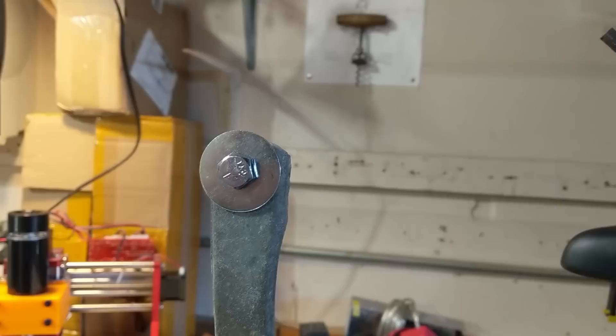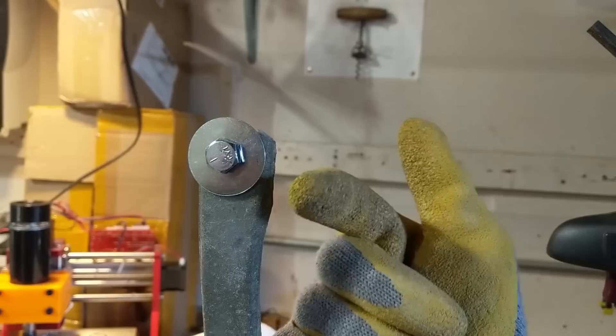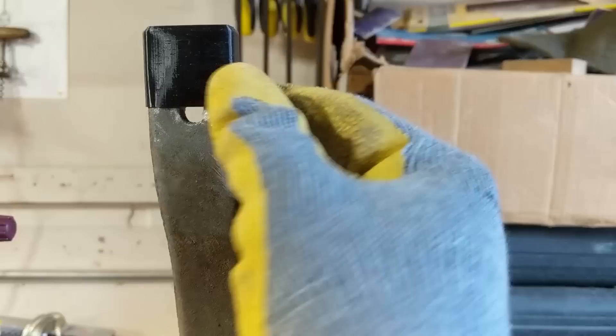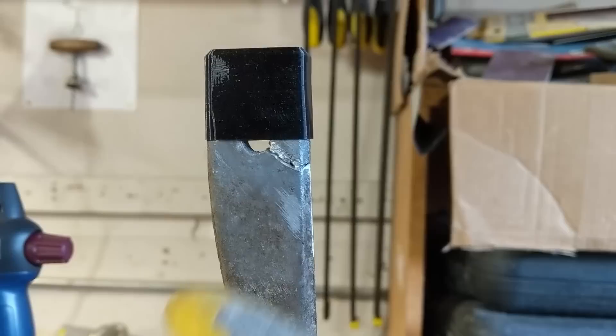The way this is going to work, I'm going to use one of these big fender washers to hold it in place. This piece is always pressing upwards — it's not ever pressing the other way unless you do something bad like hit a curb. I've also 3D printed this flexible sock that I can just slide right over it, and once slid down I can drill a new hole through the sock. This will also get me a little separation between the aluminum and the steel frame underneath the motorhome — I think this is the ideal solution.